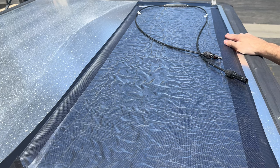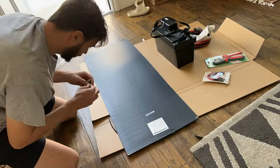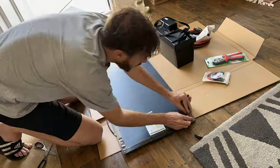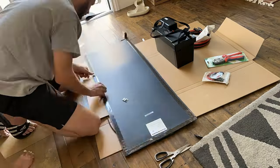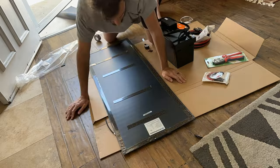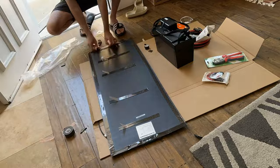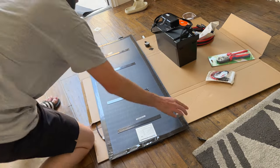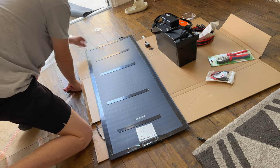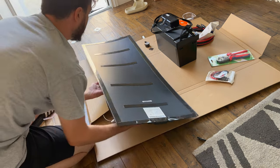This is an important part: when you get your heavy-duty outdoor double-sided tape, make a full rectangle around the solar panel and do some strips in the middle. The rectangle around the outside is to keep water from intruding underneath the solar panel — you want to limit the amount of moisture under there. If some gets in it's okay, but create a nice seal on the outside, like a gasket or an O-ring.